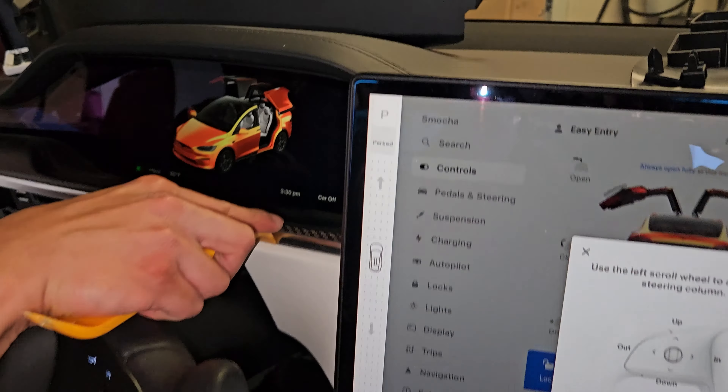From here this panel needs to come out as well — just pop it out, then move the screen back to the center. Come to the passenger side and remove this piece the same way. Once this is all removed, there are two bolts — you're going to want to remove the farthest one on both sides, the one closest to the frunk side. Remove it from the passenger side unscrewing towards the frunk, and also from the driver's side.